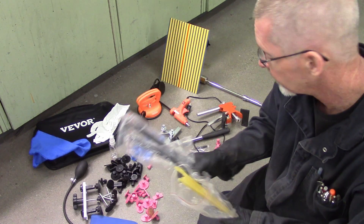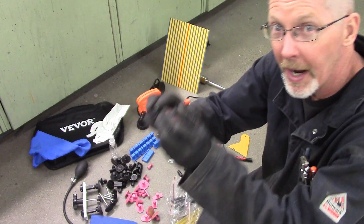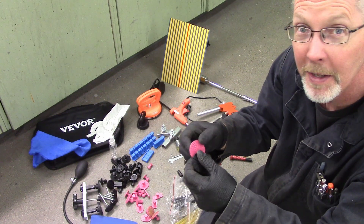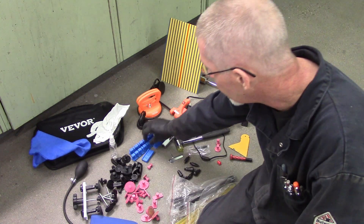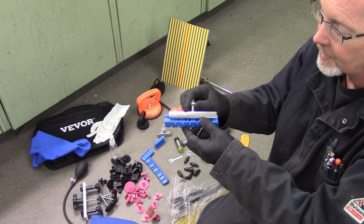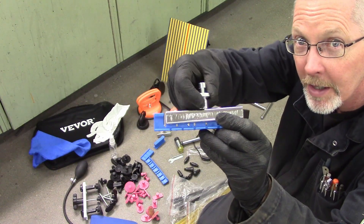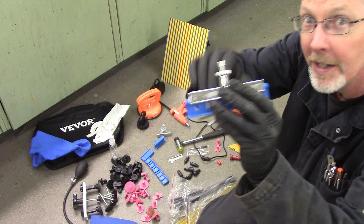The black glue is hard to get off the paint — there's probably a trick to that. The glue-on pads come in black and pink; I don't see a difference in their flexibility, so I'm not sure what the difference would be — I guess it depends how you're feeling that day. Leave a comment below if you can help me out on that one. There are these pads with a bar on them, which is cool because you can have the bar fit whatever bizarre shape you've done to the body. You put the slide hammer on here, and as you bang it, it pulls the lowest parts up — so in theory it's all a nice straight line when you're done.